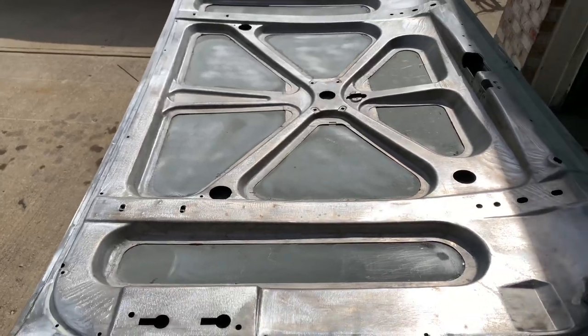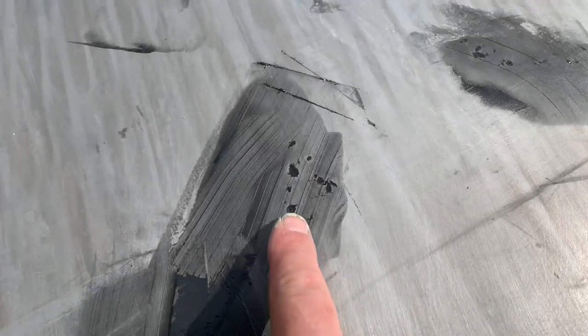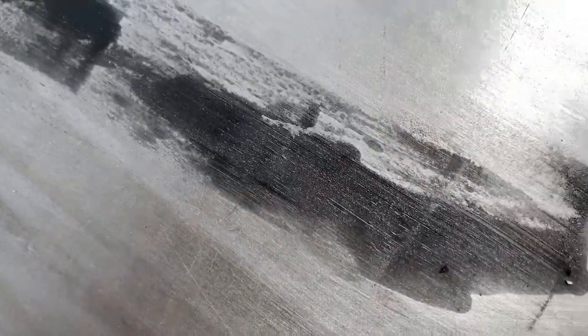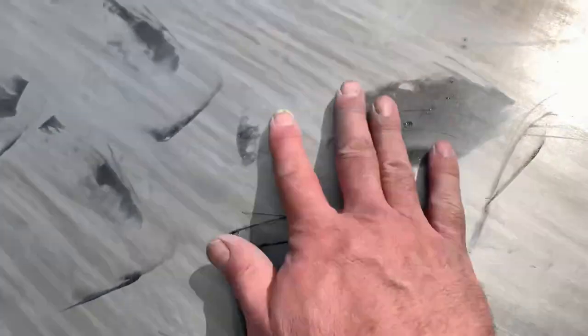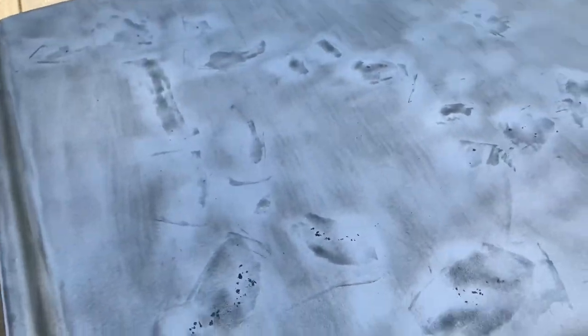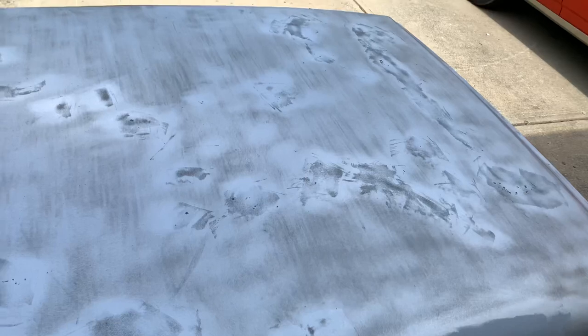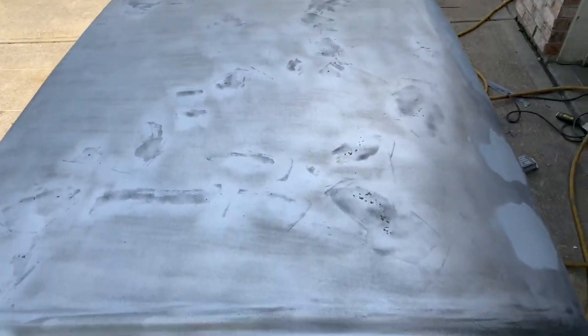The inside is done — let's flip this thing over and take a look at the top side. The adhesive squeezed through like stalactites. As it was curing, I leveled it off — you get about 90 minutes of work time before it sets hard. I'll let this cure, then sand everything flat. You can really see the pits being highlighted, but this thing is glued and sandwiched — I don't see it moving anywhere. I think it's a better alternative than welding and warping the panel, but this is a bit of an experiment. I don't know if anyone's tried this before — great idea or epic fail, but I'm hoping it works out.